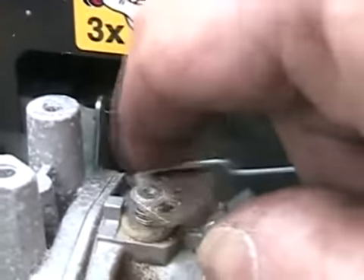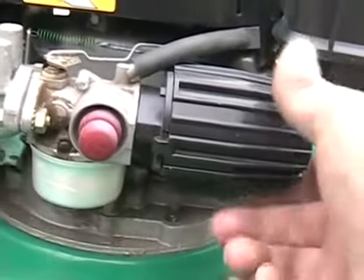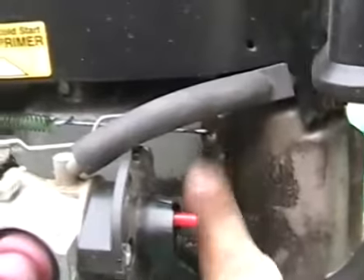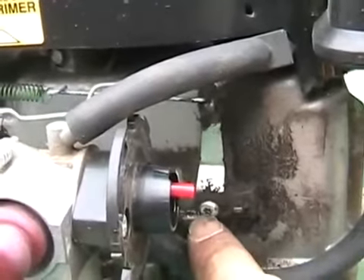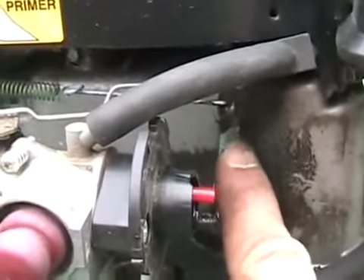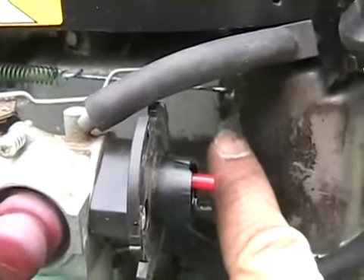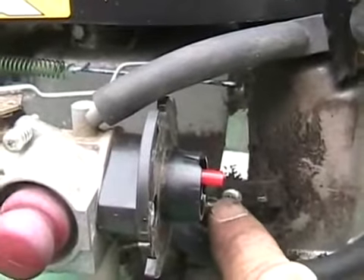Always make sure your throttle's not stuck. The other way you can override all of that is just remove the air cleaner — sometimes it comes off in a box. There's a linkage arm on a little elbow. Loosen that screw a tiny bit, and then you hold this horizontal arm with pliers and just slightly move this arm. It's very sensitive — you only need to move it like a sixteenth of an inch to make a big difference in speed. Then just re-tighten the screw.